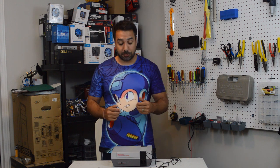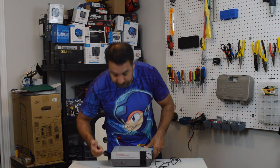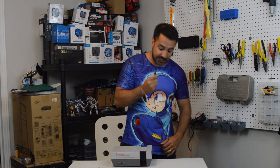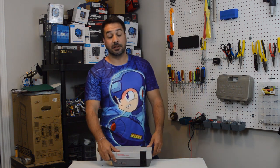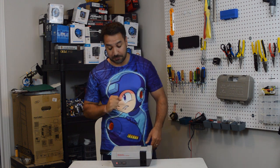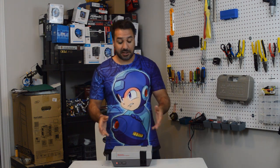Thinking I would have a really interesting problem, I did a few preliminary tests once I got the NES home. With the original AC adapter we power it on and we have nothing. However, before automatically assuming the problem is coming from the Nintendo itself, the first step is I always plug it into a known good power supply. To my huge surprise, if we plug in this known good power supply and press the power button, we have our blinking red light. There's no game in it which is why it's blinking red, but I tested it on a TV and we're getting the blinking screen, meaning it is actually outputting video — which is a very good sign because that means this Nintendo will probably be repairable.